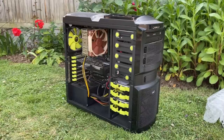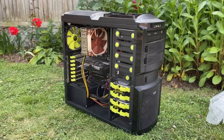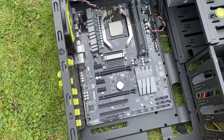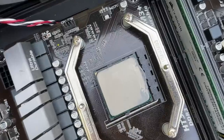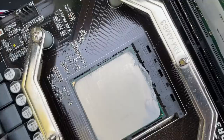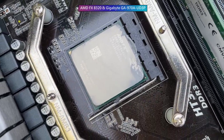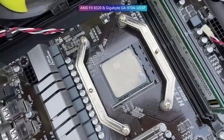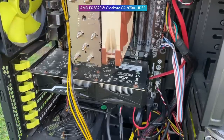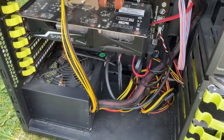So far we've had a couple of nice surprises and a couple of not-so-great discoveries. With the mystery of the CPU still unsolved, it was time to wipe off the thermal paste and take a closer look. The Cash Converters website said a 3.5GHz FX processor, so I assumed it would be an FX 6300. What I didn't consider, however, was the FX 8000 lineup, and it just so happened that underneath the caramel and toffee coloured cooler sat an FX 8320, atop a Gigabyte GA970A UD3P board. I got more than I expected from this system, though I sort of also expected the generic PSU — always budget for a decent PSU, no matter what system you're building.